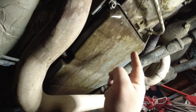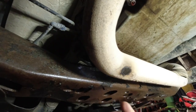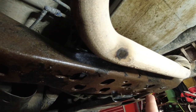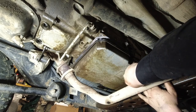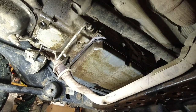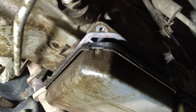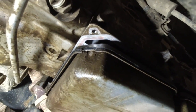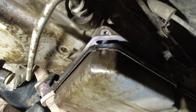I'm going to loosen the top two bolts in the middle, get my oil pan drain placed underneath, and use the vacuum sucker to suck out whatever I can. This will lower that pan down enough - perfect - and I can get the evac in there to suck out the rest. You can see the gap now where I put the evac sucker, and you can definitely see evidence of oil going past the gasket there.